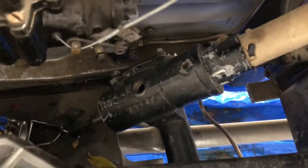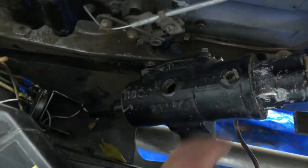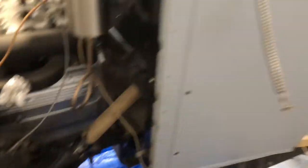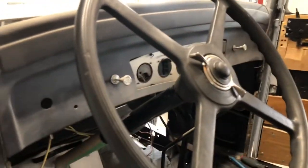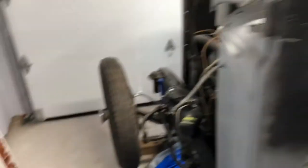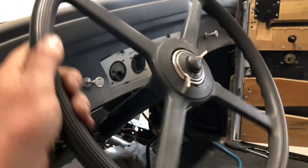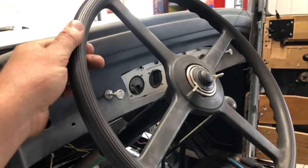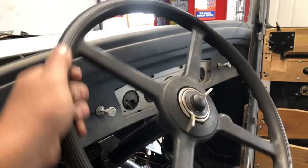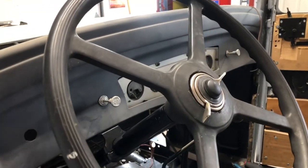I've got the plate put on the back here. It's pushing this way against this cam lever, and that comes out here. We should have a couple inches of play in the wheel or else it's not done right. That actually feels really good — you can see the wheel moving there. There's a little bit of play, meaning I can go about that much with nothing happening to the wheel. That's what cars used to be like. That's why in old movies some guy was driving doing this — it seems ridiculous now, but back then you had to do that to keep the car going straight. So that's a success.